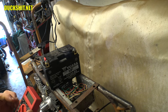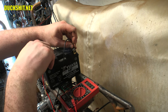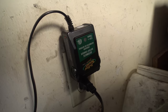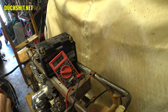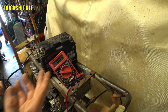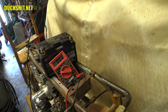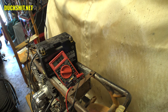Alright, the next concern was this battery. Right now it's still flashing red over there, and I'm getting 12.6-something volts — 12.6364, it's flickering. As I thought, it's just not charging it. Flashing red light means not charging. I don't think the fuse is bad — nope, fuse looks good. They do have a nice inline fuse here and that's very obviously not bad. It could be because the battery is just fully charged and the charger knows that. Let's go ahead and put the battery into the bike and try to crank it over.